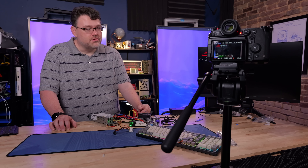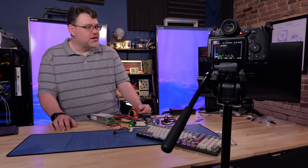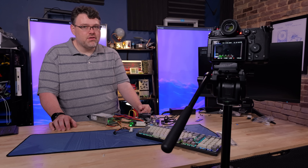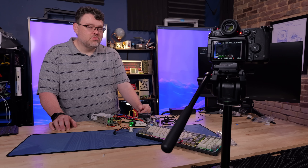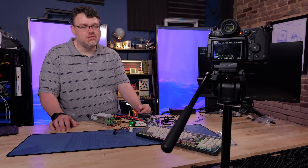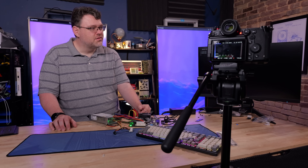It is what you get — a single PCIe slot. If you really get your back up against a wall, you can turn those M.2 slots into a PCIe slot; it's 4 lanes, but I don't know how much I'd recommend it. This platform also supports AMD's RAID mode on your 2280 M.2, but I don't recommend that. Especially if you're going to run Linux, just run Linux MD. You don't need AMD's RAID.